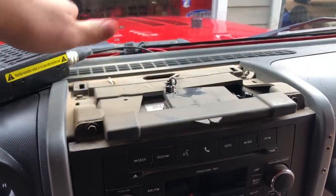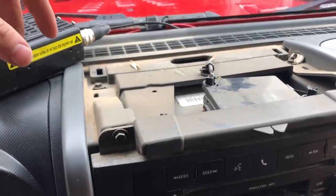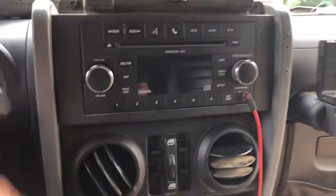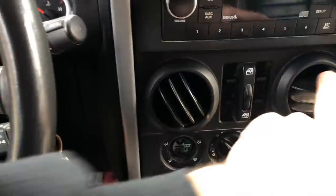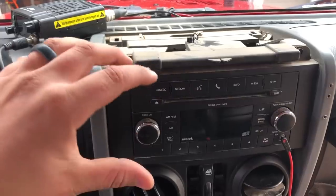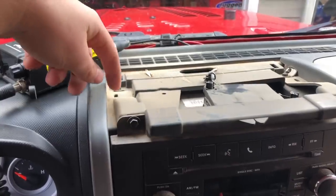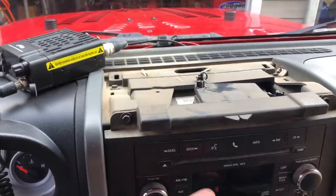What we were going to do is remove this tray completely, and now we can see if we have two bolts here. I only have one. Their instructions are online and they tell you that if you only have one screw right here, you are going to have to remove the radio a little bit so you can put another bolt in there. In order to remove the radio and dash on the 2010, it's pretty simple — peel back this lower panel, take all four screws, then the radio screws, and this should pull out. I'm not going to do step-by-step because there's already a ton of videos on how to remove this center section and radio on YouTube. We're going to get this out and show you how to install these two bolts. If you already have two bolts right here, you can skip a bunch of the instructions and it makes it a lot easier.